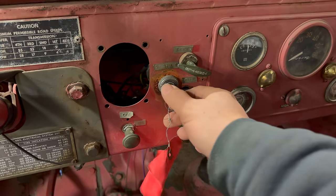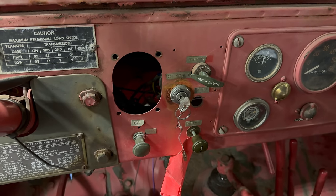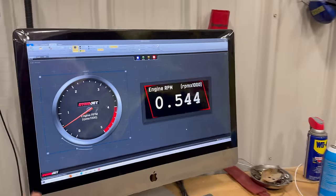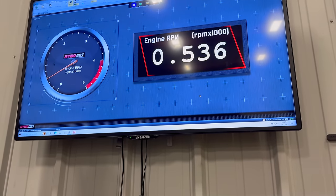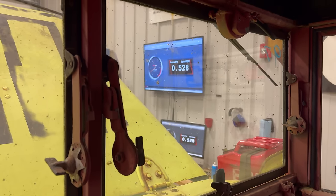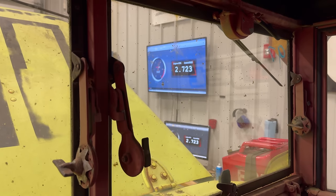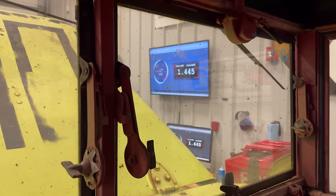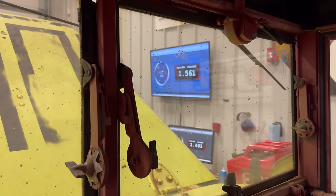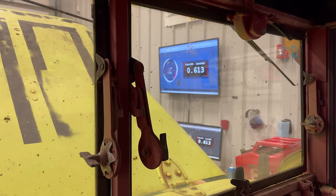I have it temporarily connected up. Let's see if the truck even runs. It runs. I've connected up the tach signal from my dyno jet so I can get a very accurate tach signal and see the reading from inside the vehicle. I'm going to rev it up and see what it sounds like when we hit the rev limiter. It's not letting me go up to 3000 — 2911 I think was the highest I saw. It's not popping or banging, so it's definitely working.